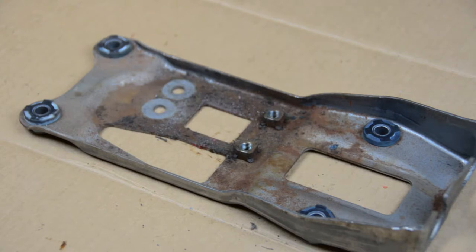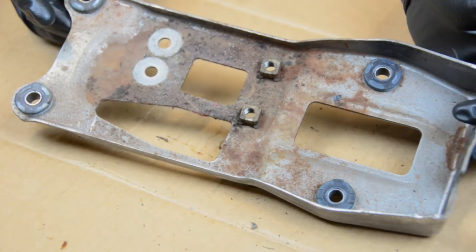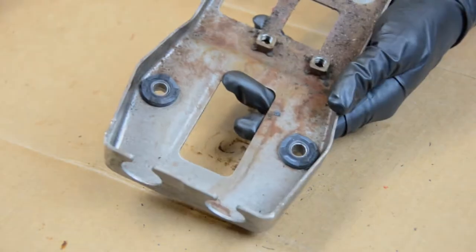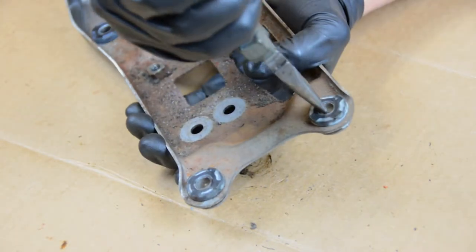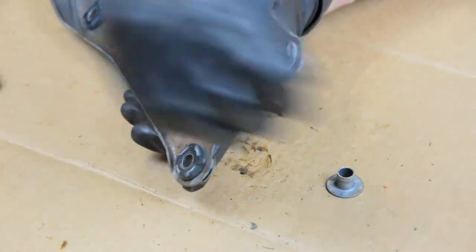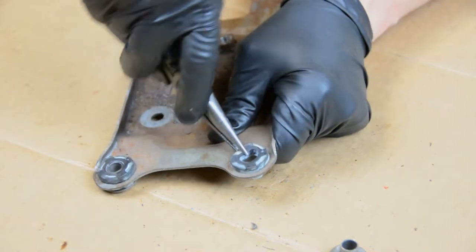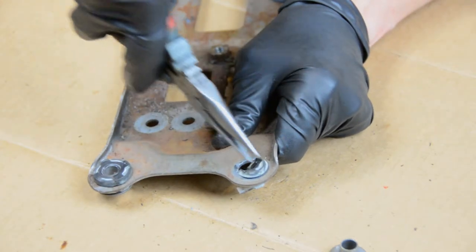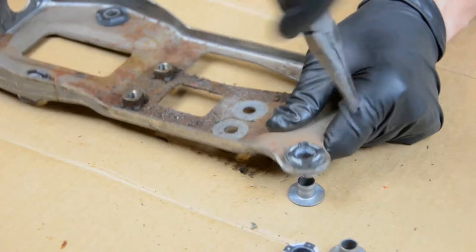Here's the shifter base - this is what everything attaches to. Here are the four bushings that attach it to the chassis. On the other side there's like a little metallic washer thing - it's all one piece. What you do is just push them out. Stick the tool in there and push - it comes out. There's the metal piece. To get the rubber bushing out, it seems a lot harder than it actually is - you're replacing them anyway so you don't care what they look like. Just sort of grab and push it through. Do it to all four, and you can totally reuse the old ones if you ever want to restore your car back to factory.